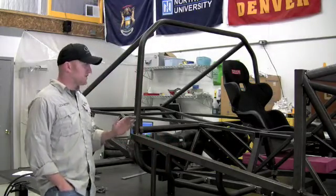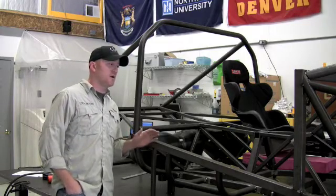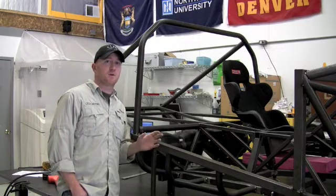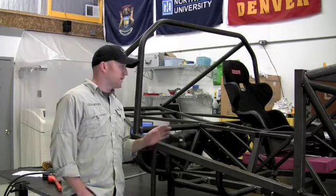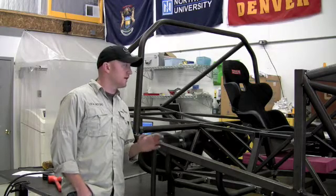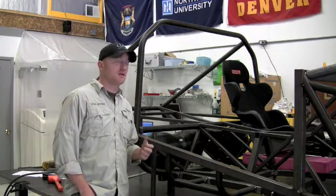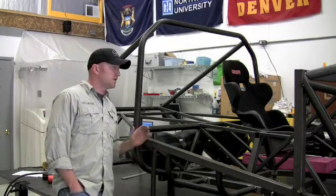As you can see, it's a pretty complex matrix of 3D tubes. Versus the monocoque chassis design — which is simple in its manufacturing process, basically a process of stamping the body and sending it down the line — the space frame is more complex and a little difficult to make. But in terms of cost, it's much less expensive to produce because the tooling — the dies and tools to press the bodies — is not as much equipment needed to produce these chassis.